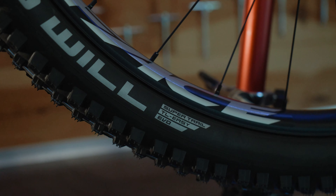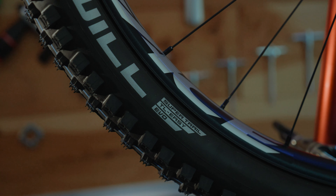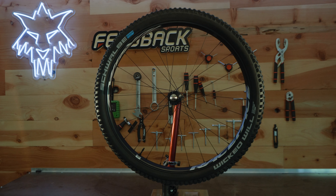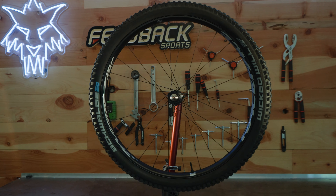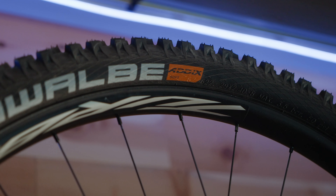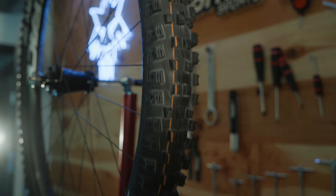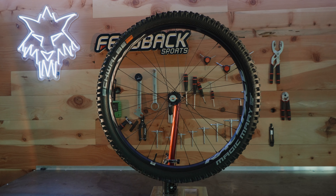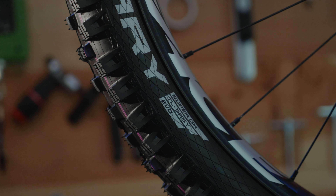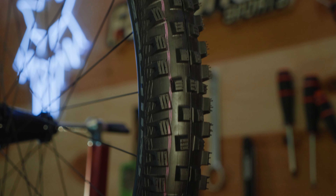When we go from Super Ground, we then have our Super Trail casing. Super Trail adds a layer of apex right at the bead area, eliminating pinch flats — that technology came from when we started doing plus-sized tires and got more rim strikes with higher volume tires. Next is Super Gravity, which is your more enduro-style casing with a sidewall very similar to downhill casing but still supple under the tread area. Then there's Super Downhill — your super aggressive downhill casing for putting on the big bike and smashing through things.